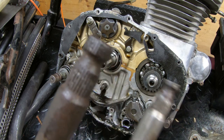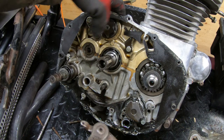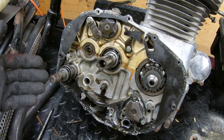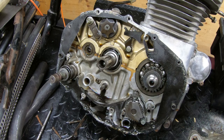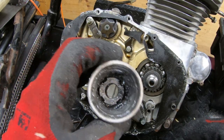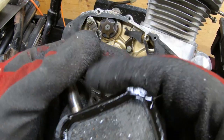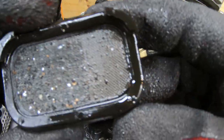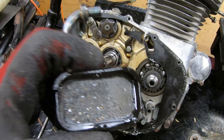I'm gonna put it onto the original shaft. So there's my donor — get that on the wire wheel, just to clean that up. I already have a new seal on the other side. While I'm in here I'm just gonna redo all the seals I can. The other couple of things you saw me take off was the oil cup — that's gonna go right in the parts washer — and the oil strainer. So this is the pickup; there's some stuff in there, it obviously did its job.